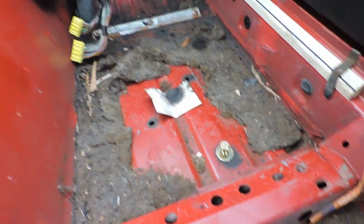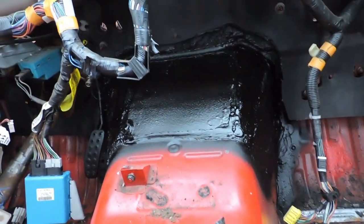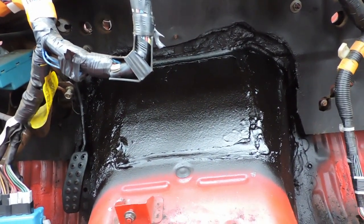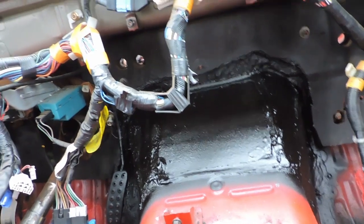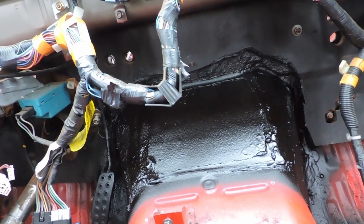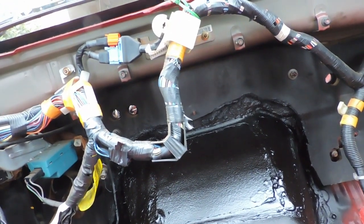Next, what I'm gonna do is continue to put down these bolts for both sides of the chassis bracing, and also get the front ready to seam seal and apply undercoat to it. I'm gonna do 2 coats up front just like I did back here. It doesn't use too much undercoat. I could probably get everything I needed undercoated, including the chassis braces and both sides of this, done with just 2 cans of the undercoat, and both cans probably combined cost me like 20 bucks.